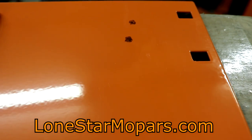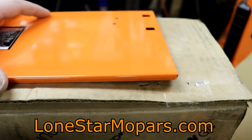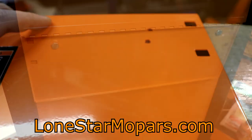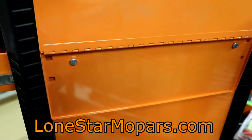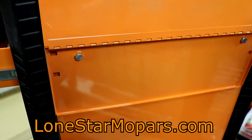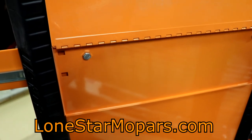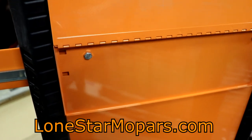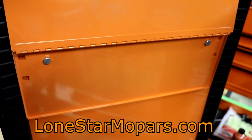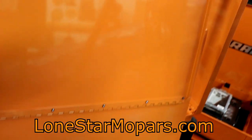It's probably advisable to drill the top hole first, make sure you have everything in place. If you want to slot this for adjustability side to side or up and down, you can do that. Went with 5/16ths — looked like that was going to correspond with M8 fairly well, and it did. Deburred, filed, cleaned it up. On painted surfaces, I recommend masking tape to protect the paint as much as possible. The reason I'm filming this now is just so you can see that it fits, that it actually does go into place. As I come up — that is the best way.